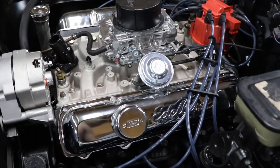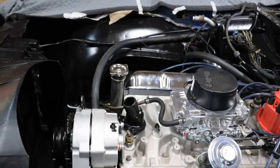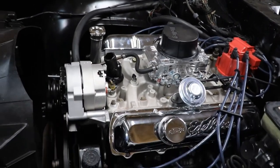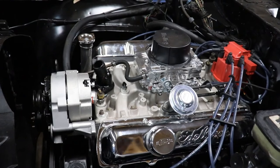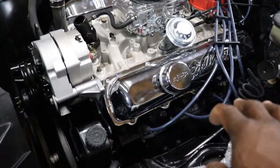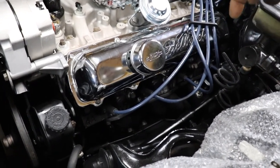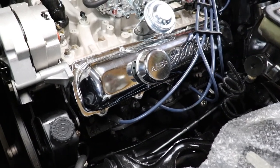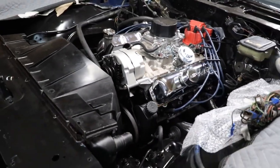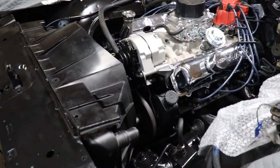As I said before, we got our EGR valve on, our throttle linkage is set, we got our heater hoses connected. Actually, I got one still off over there, but I left that off for a reason. I gotta make sure the hose is gonna fit that fitting. What else? We got our headers on, but I'm still waiting on the column linkage that goes down to the transmission. Well, it goes from the column down to the transmission. We're waiting on that bushing that goes into the frame down there. So we pretty much got everything mechanical wise on the car on it, like our alternator and stuff like that.